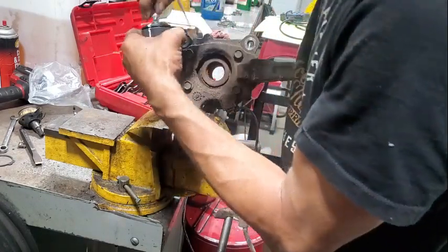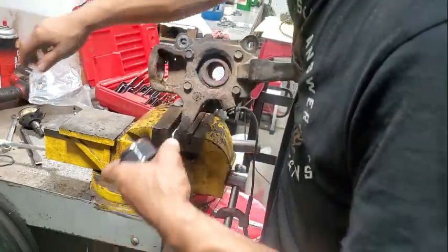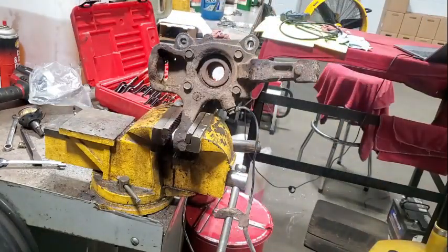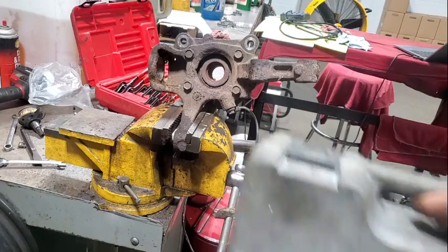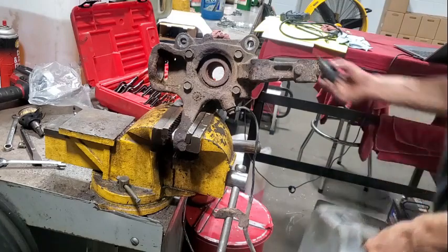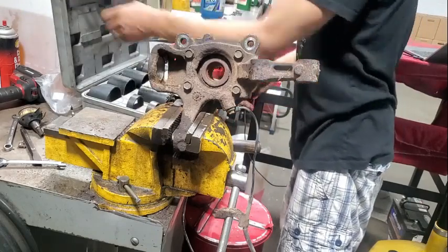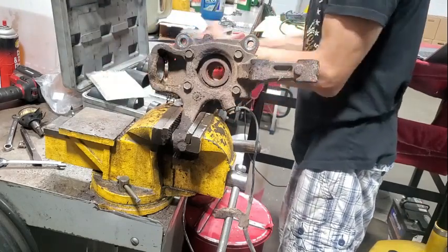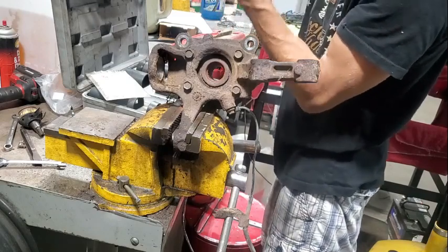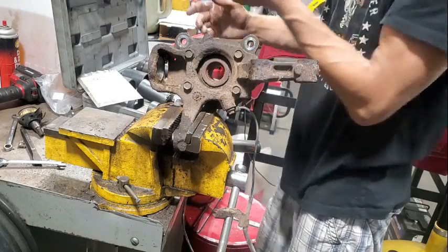Take this work back out. And we're gonna need something to press this in, so let me grab some cups. If you're looking for a cheap deal, ETD makes a pretty good little kit. Random cups. That one should do. Make sure it gets around that boot so we ain't pinching it. Nope. Maybe this one. That's the one. Right there. Okay.